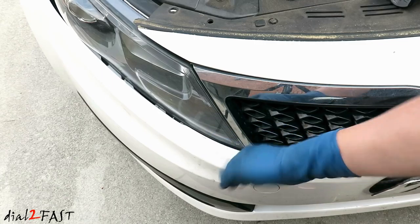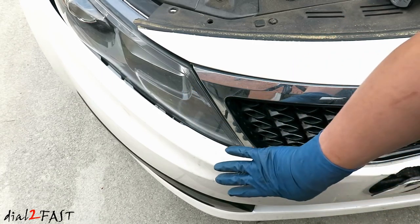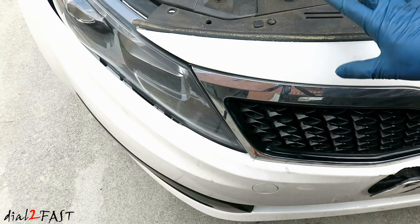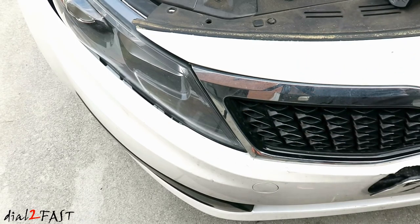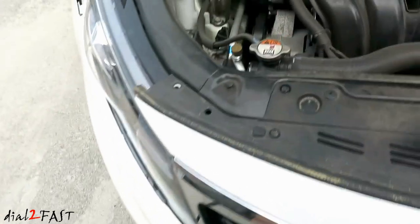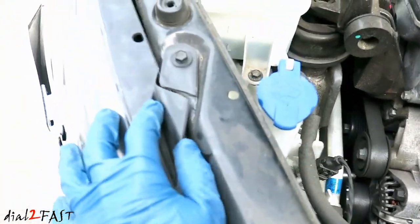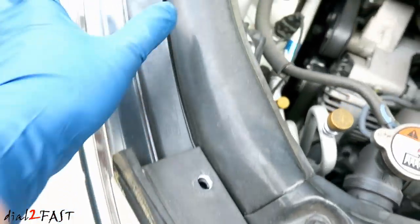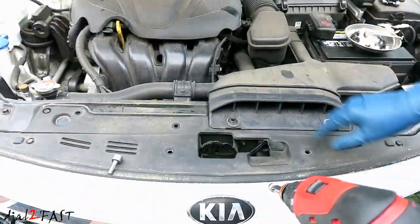Let's open the hood. If you look on the passenger side, this bumper is actually higher than the headlight itself, so I can't just push this back in — it's gonna hit the headlight. So I'm gonna need to remove the bumper. The impact was pretty big because you can see the clip on the headlight is totally loose and it's missing clips.